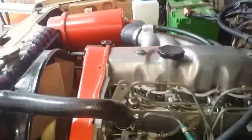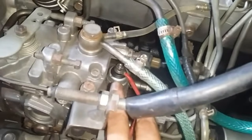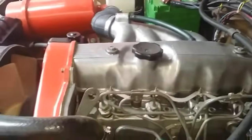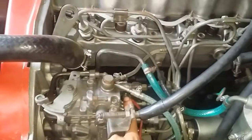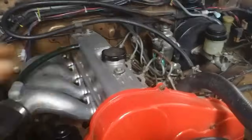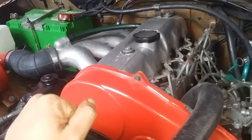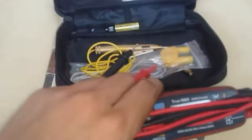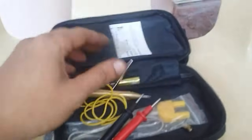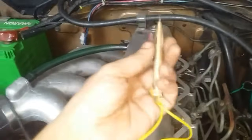When you turn the switch off, the solenoid closes and stops the flow of diesel, hence your engine shuts off. All too often when you have a cranking no-start problem, especially on this engine, this is oftentimes the culprit. However, before you condemn it and buy a new one, it is important to conduct a process of elimination — that way we can be sure and avoid wasting money. Get your multimeter, or if you don't have one, a test light like this will do, though a multimeter is preferable.